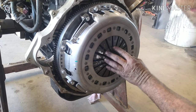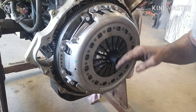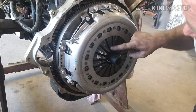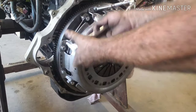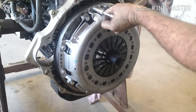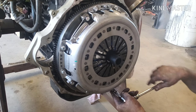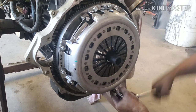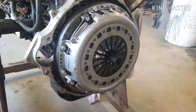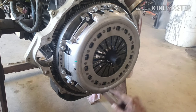I'm trying to get you close in here so you can see what I was talking about with the fingers — these need to be flat. To get this square, you just want to make sure it's nice and flush. These bolts aren't tight right now so we're going to go in with the speed wrench. When I tighten this one, these are going to start coming in. As you go around, everything's going to start to flatten out — this needs to be flat. See how uneven it is now? As we come down here, these are going to start coming in. See now you've got these popped out, so I'm going to go around and tighten everything flush, then come back and torque in a crisscross pattern. I just wanted to show you guys what that would do.